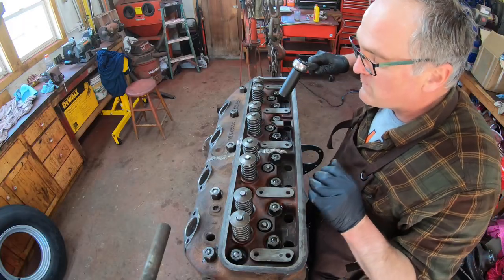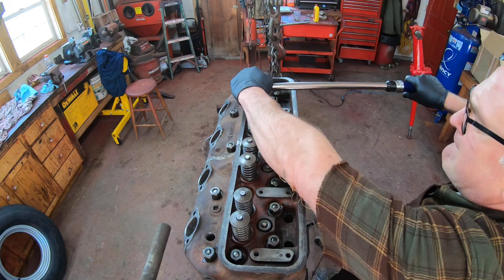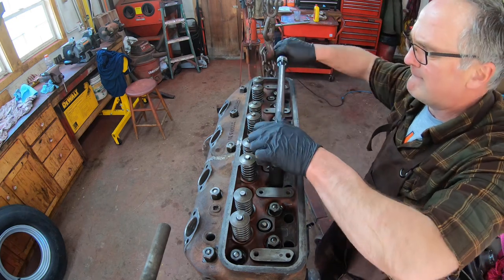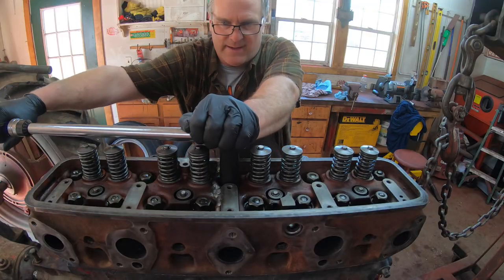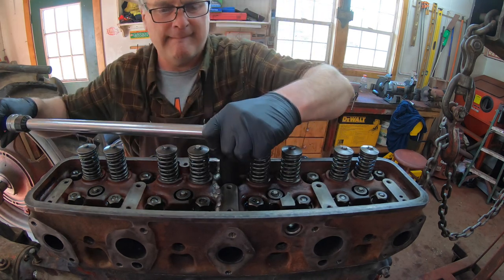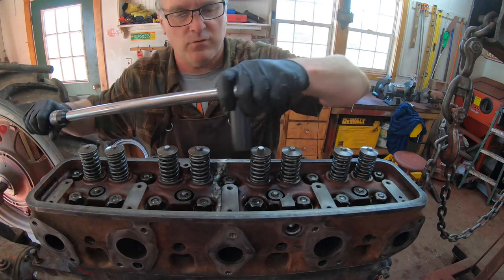I went all the way through and torqued them all to the intermediate, and now I'm going to torque them to, I think I picked 125 foot-pounds out of the 110 to 135 range. Now I'll just go through and check them all a final time, and usually, some of them will take more. And then I run over them a fourth time and make sure none of them move anymore when they hit torque. There, I'm done torquing down the head.